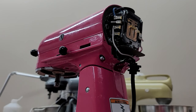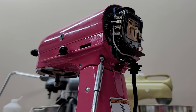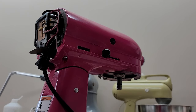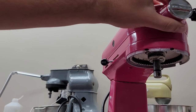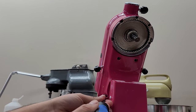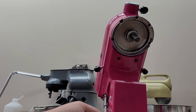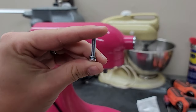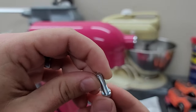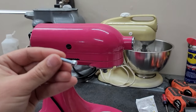Take note of the two different screw sizes: the full-body threaded screw goes into the lower housing, and the one with a straight shank goes into the planetary. Now moving to the back of the machine, take out the two screws — one on each side. Sometimes it may be easier to tilt the head up and turn it towards you to come in at an angle to access that screw. Be careful when removing these so you don't damage your paint. Note that there's a little lock washer in there that helps hold it in place. If you find you're missing any of these screws, contact us — we have them available.